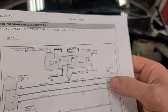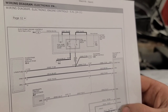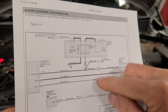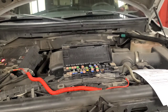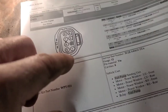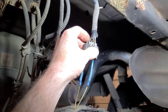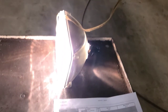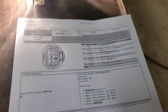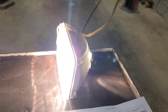At the fuel pump control module — not the actual fuel pump — pin 1 is power and pin 4 is ground. I've got a pin-out for connector 433. There's a connector in between which is a logical place to test and look for corrosion in the connections. At the fuel pump driver, pin 1 is power from fuse 27 and pin 4 is ground. I've got leads into those two pins — you can see the black wire and what looks like purple and green. It runs about 4 amps with a headlight. So let's bypass the fuel pump driver module and connect it so we can make the fuel pump in the tank run directly, and check the current flow.